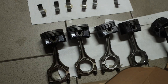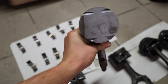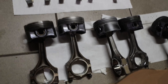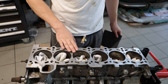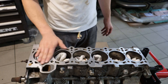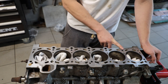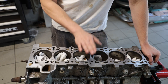Now I'm going to show you our 'new' pistons — and by new, I mean properly cleaned. I did this while I didn't have the camera, but they look pretty much new. There are a few really hard carbon deposits I couldn't get off, but for the most part they look really, really good. Before, the carbon was like half a millimetre thick. Now I've scraped off all the head gasket material and gone over it with fine scotch-brite, so there are no more hills from stuck gasket material and you can still see the machining marks — we didn't take off any material, just removed everything encrusted onto the block.